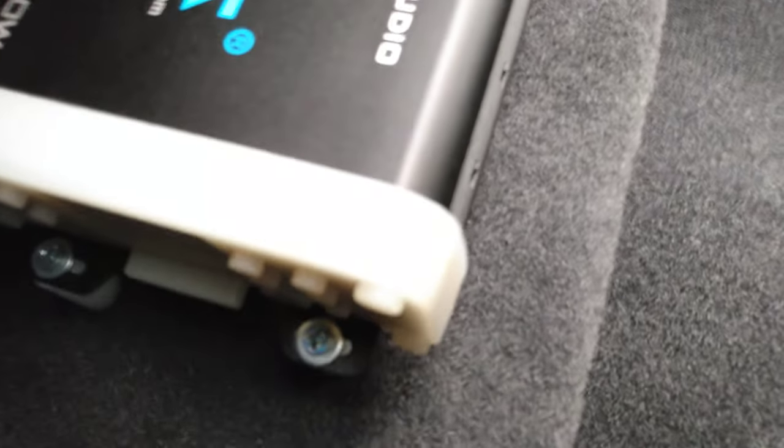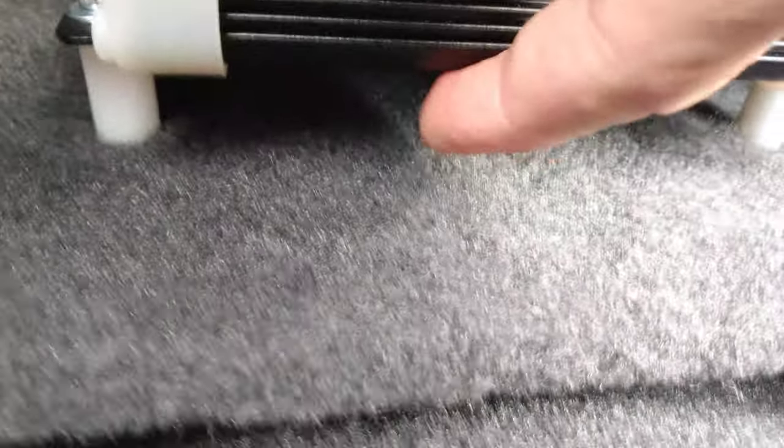Okay, now the radio, this is a Sharp system already in. There's all the wires, it's nice and neat. If you remember, I made some videos a long time ago where I had two-sided tape up here. Well, every 3 months I had to keep spending money on two-sided tape, it cost me more than anything. It just kept falling because it does get hot. That's the reason why you want to have spacers. They're 2-inch spacers. It raises it up. And you get that at Home Depot, and the screws.